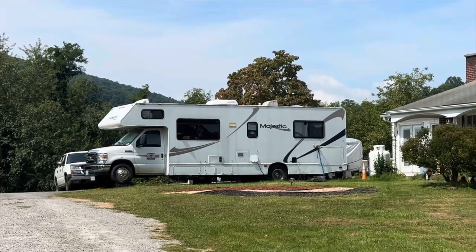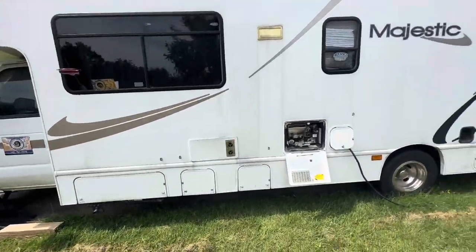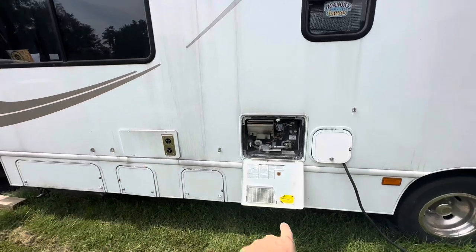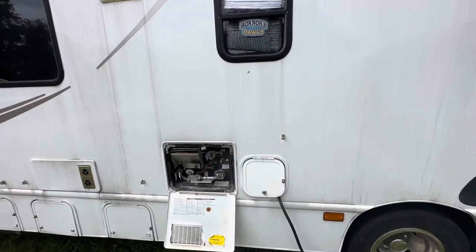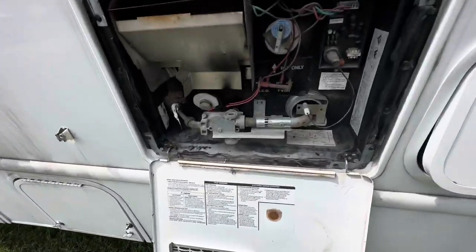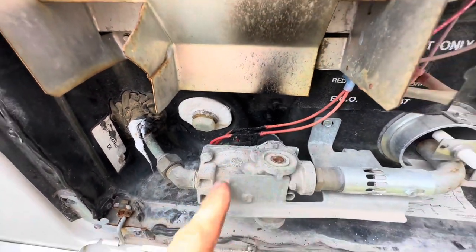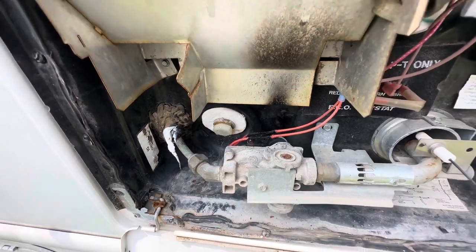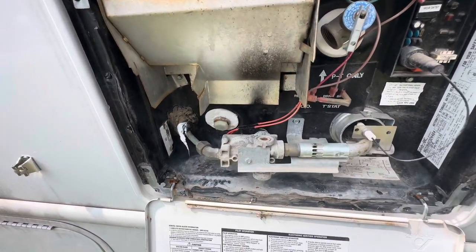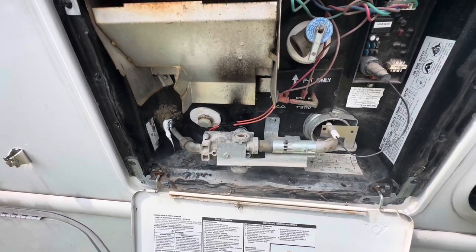No blowing up, Doc - we love you! The reason I was asked to come is because Doc was smelling propane both outside and inside the camper. I came to check the usual suspects: a heater, a propane refrigerator, and a water heater. When I opened it up, that right there is the control wires to the unit - that's what controls the gas coming in to the water heater, and that's where our propane is coming from. I've got to look up the parts - that should be easy to repair.